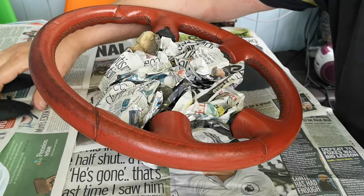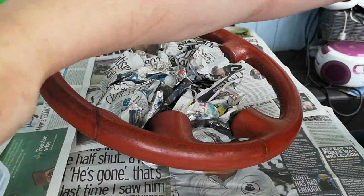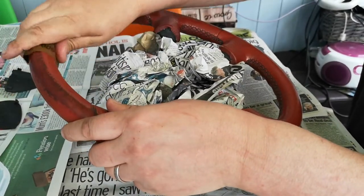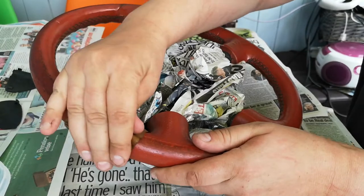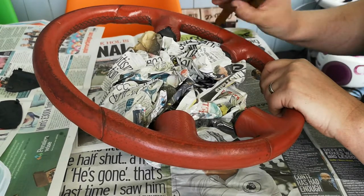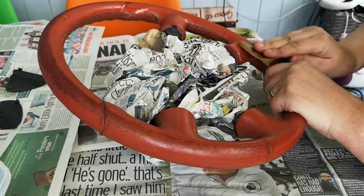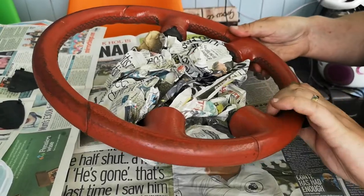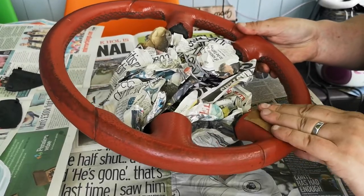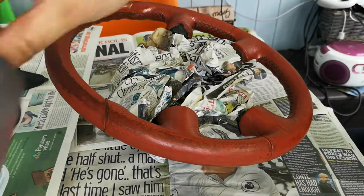A little about airbags if you're going scrapyard hunting. When I was removing steering wheels, I removed one from a 2003 Tempest simply because it was blue, which I thought would go well with the Micra's interior. Further on in the yard I found the Sport Plus and took that steering wheel too, so I've actually got both. Now the airbags, although visually similar, have different connectors — the Sport Plus was a 2000 model year car, one of the first coil pack models.